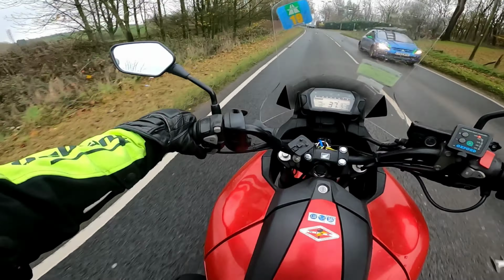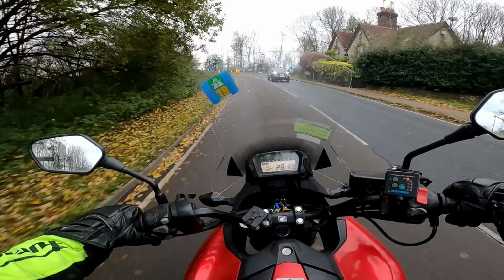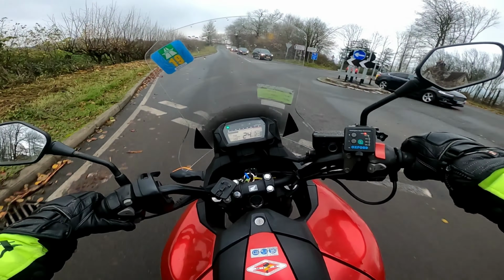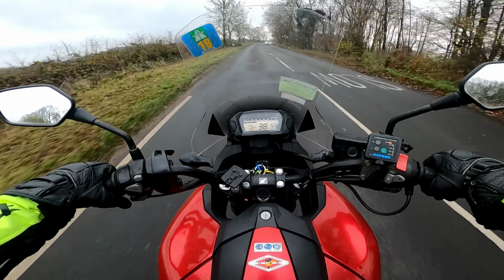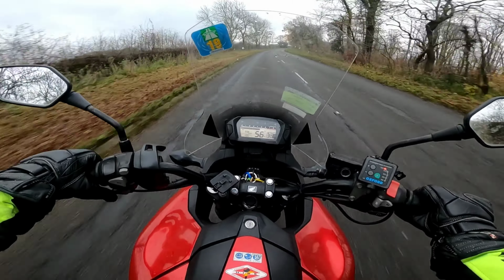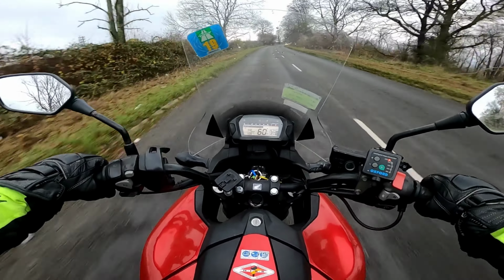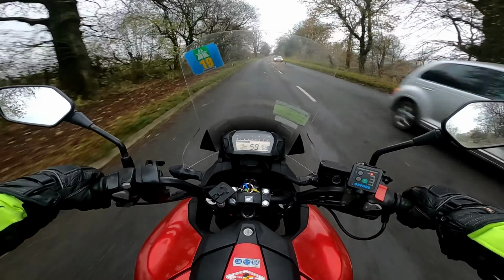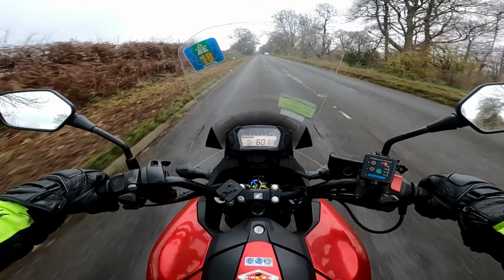On the Road 5, those carbon black edges I was talking about on the rear are nearly completely slick. They even have inverted wear dimples so you can monitor depth and wear. Michelin say that it's highly unlikely that anybody leans that far in the wet, so they've made that part of the tyre focused more on dry grip. It's worth also noting that the Road 6 that supersedes the Road 5 has tread much further towards the edge, so should be even better in the wet.